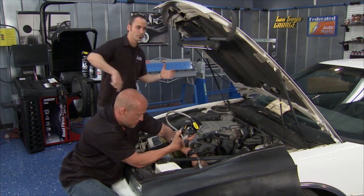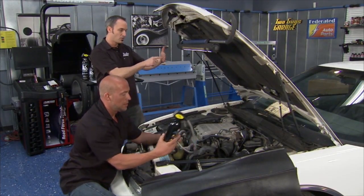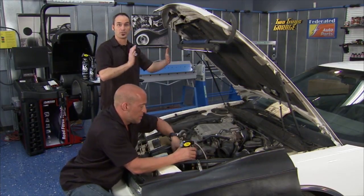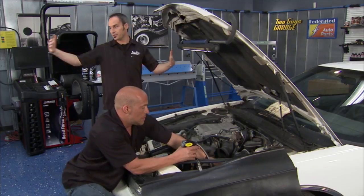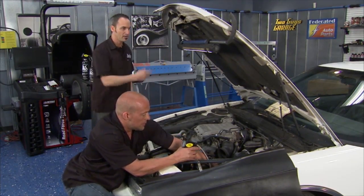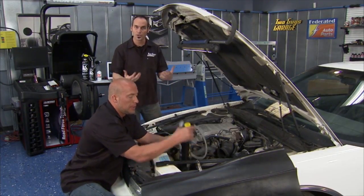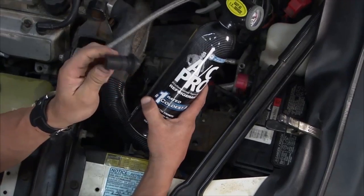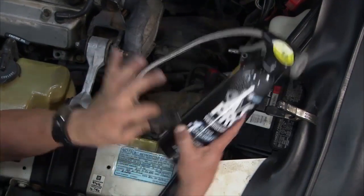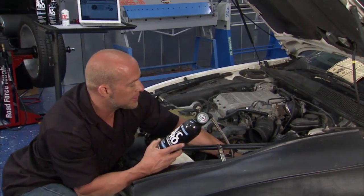The AC system is just a big loop of refrigerant, and you've got a compressor in there. On one side of the compressor is an orifice. Once you kick that thing on, you're pushing freon against the orifice or TXV valve. On the other side of the compressor is a low side — you're pulling a vacuum. So that's what we're going to tap into is that low side. Now I'm going to fire this thing up so we can get the system running, see what kind of system pressure we're looking at.